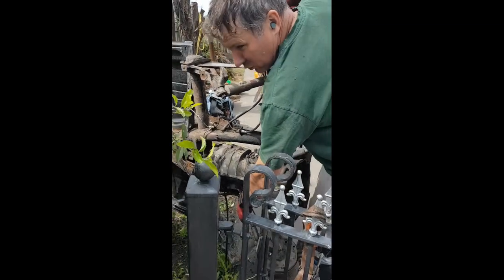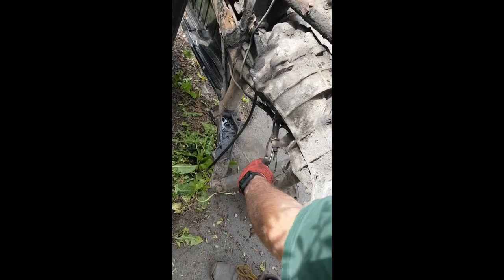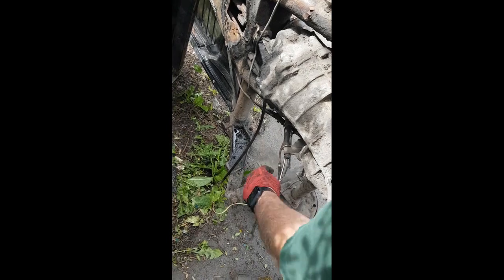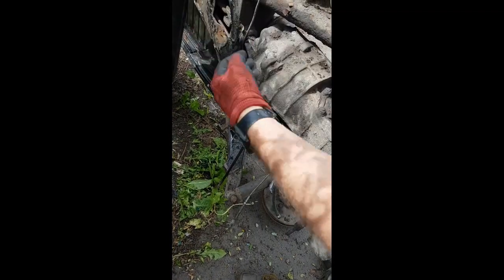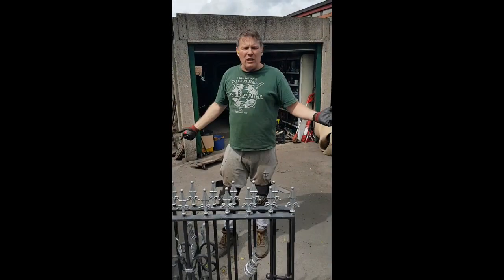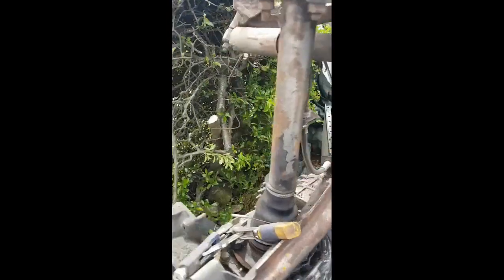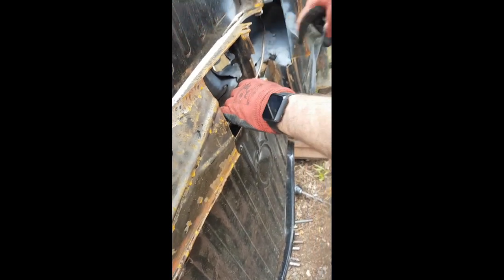Guys, here's the new fuel line. It's copper nickel, and it's 6 mil. You isolate it in from the back end, so you just have to put it out of the way of the gear linkage. That's the only thing. Put it underneath, travel it through, you can see it through in there, and there's a hatch. I cut a little thing here to cut the tab off the old one. I took the old one out, everyone leaves them in. It comes through here, you crimp the tab over, goes in this hole, and ends up out here.